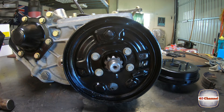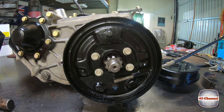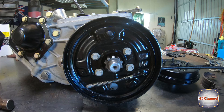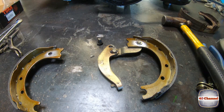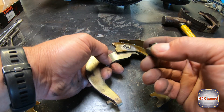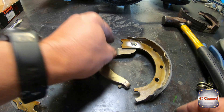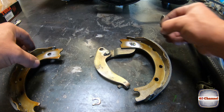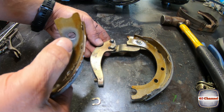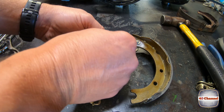The handbrake. First thing we're going to do is just slide in and see our handbrake cable. We've got our little support pins. With the support pins we push them through and then the little horseshoe clip. There was a lot of corrosion on there, so I've just cleaned that up to help give me a little bit of room to get that in place.